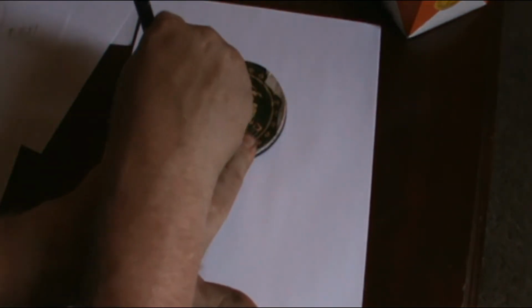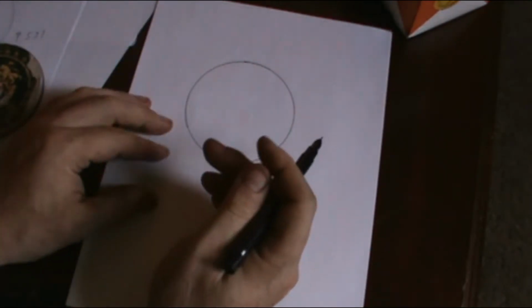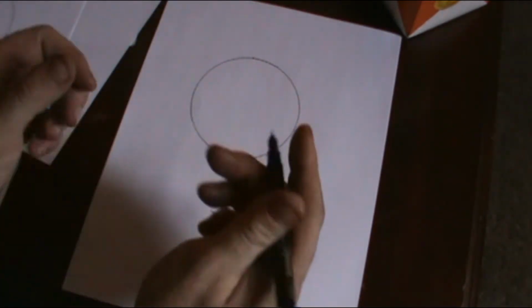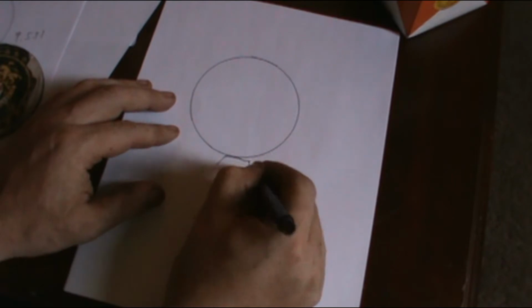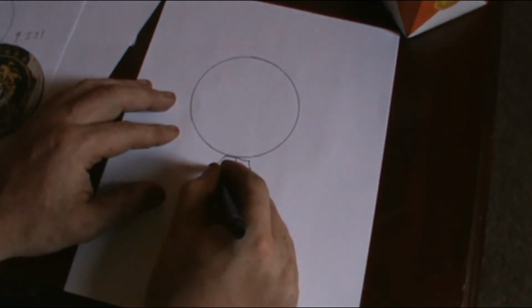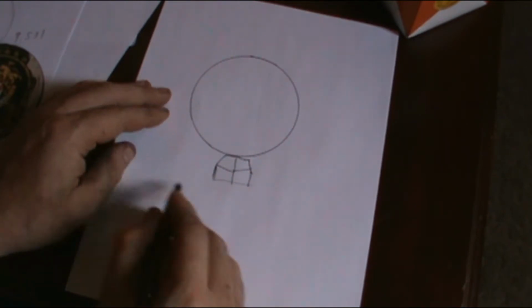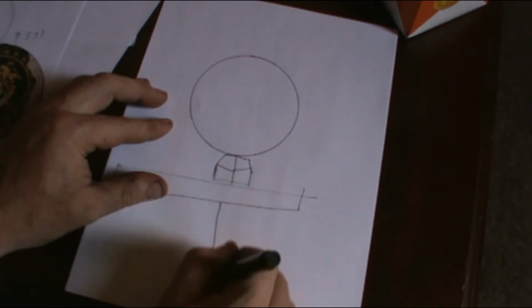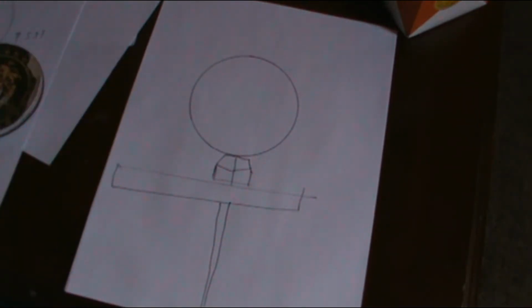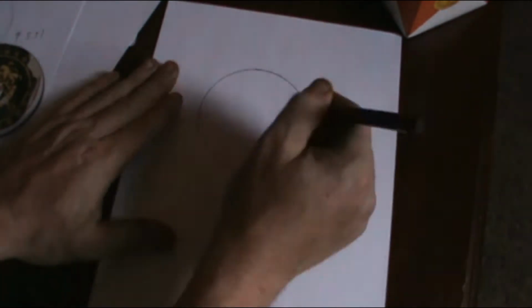I'm trying to draw this because you didn't really see it, but I clamp my depth checker into a vise, because to do it with all 4 hands is kind of impossible. On the bottom of it, there was a nut like here, and then another kind of jammed into the threaded part of the bar. Okay, and then your thing stuck down below here. Whenever you put that checker on, you're going to put it clean up to the top. I like using the vise. It just gave me one less thing to hold on to.